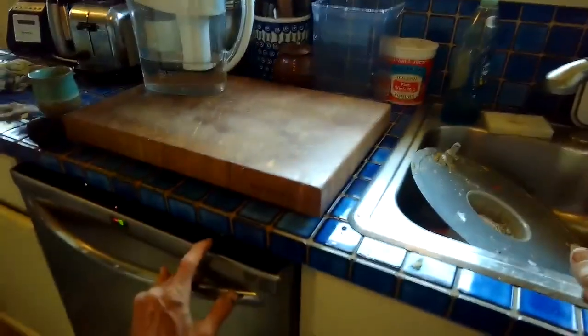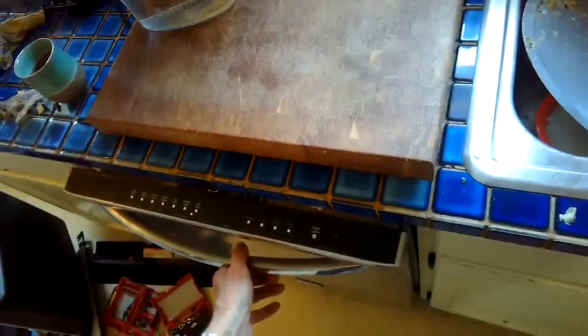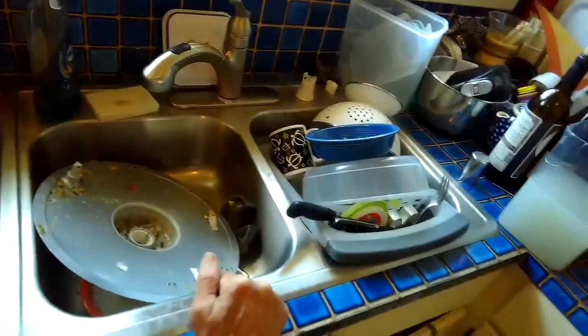So we're gonna also clean that. Next thing I'll do is I'll press cancel. I wanna see if I get some water coming out there. A little water left. I think the drain's working now. I think we got rid of the obstruction. I'm gonna close it. Yeah, so we can see a big column of water shooting up. That's a good drain. Okay, put that back on.